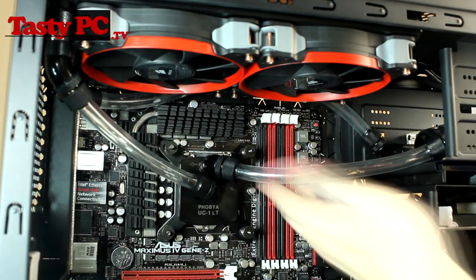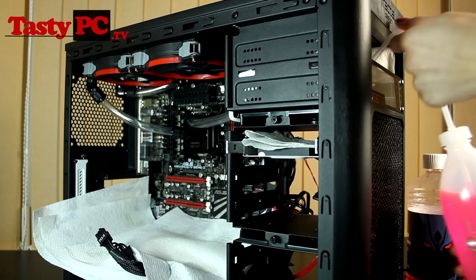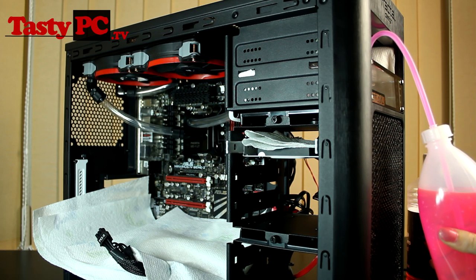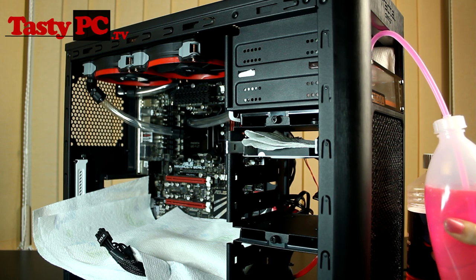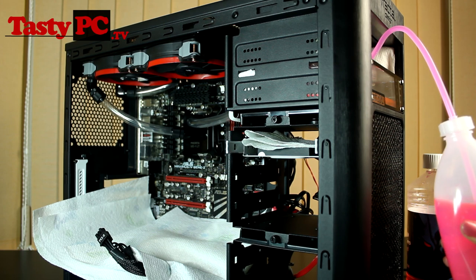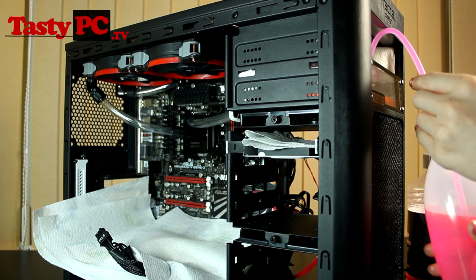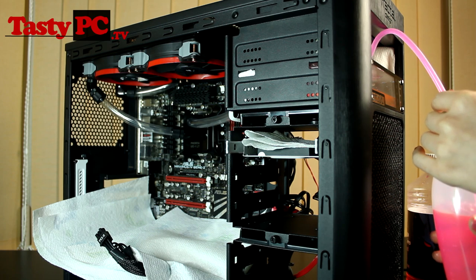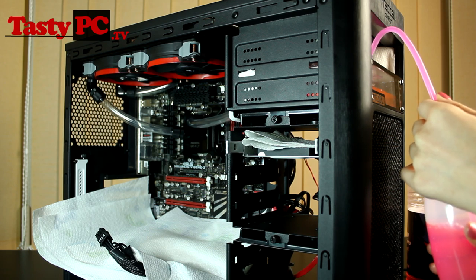I would love to know your opinion on that as well. Also, if I do water cool it, I'd love to know what colour coolant you think I should use. Now it's time for the moment of truth — filling the loop. As you can see, I have covered all of the potential drip points with kitchen roll. This is to protect the parts still in the case, while at the same time allowing me to easily see if it drips at all. A lot of people think that if there's a leak, a tube will just fly straight off and coolant will go everywhere, but if it is going to leak it will most likely just be a slow dripping leak, which should be easy to sort out. And really, if you have tightened everything up properly, you should be fine.